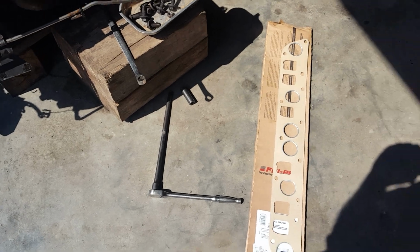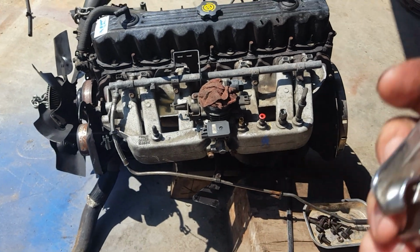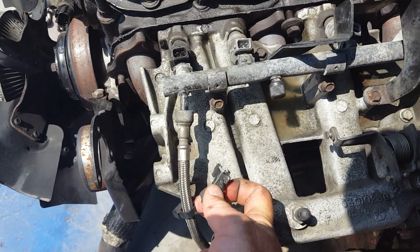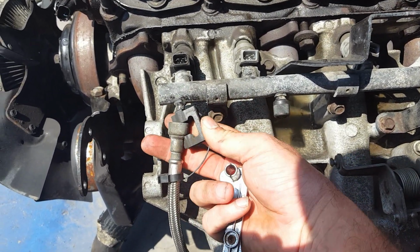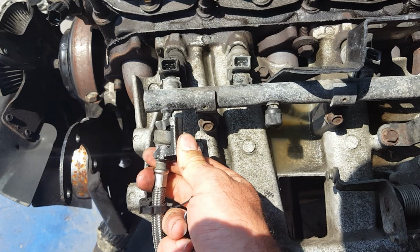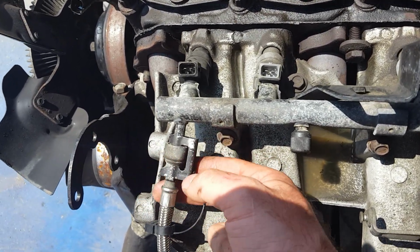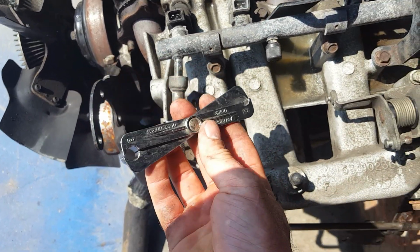Anyway, moving on. What did I do with my, oh, there it is, my disconnect tool. I wanted to show you guys, in case some of you may not be familiar with the Chrysler quick disconnects. This is your fuel line quick disconnect here. It's a 1/4-inch line, and it comes with this clamp on it. Actually, that's backwards. So when you get it, it'll be like that. And this is just a safety clamp to keep the line from blowing off if the fingers inside the connector should fail. So you just pull it off like so to begin with.